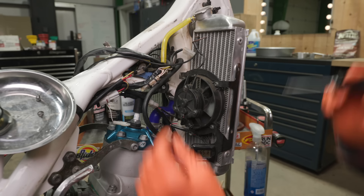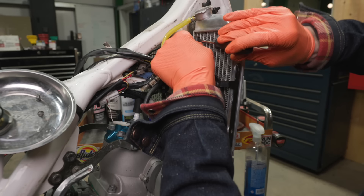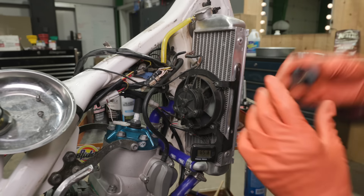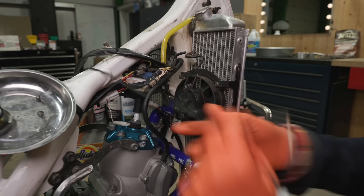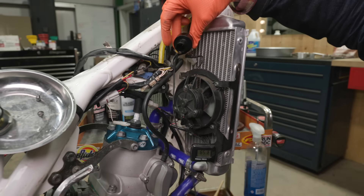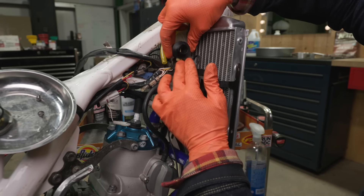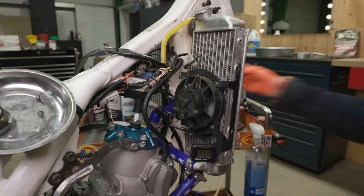You can even program that. There's a second probe in here that goes up to the gauges. Now this is not ideal — it's a quick and dirty fix to get the temperature of your bike. The better way to do it, and what we'll be changing over to, is an inline probe. It's just a much better way. Guys don't often put these in because it's more of a hassle — you can quickly stick one of those copper things in there — but I've never been really happy with it because you don't get a very accurate reading. With an inline probe you get the real exact temperature of your bike. So we'll upgrade that.